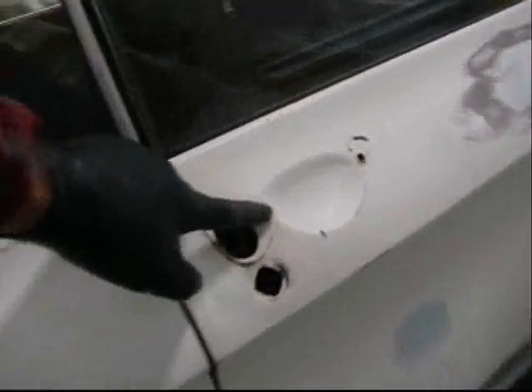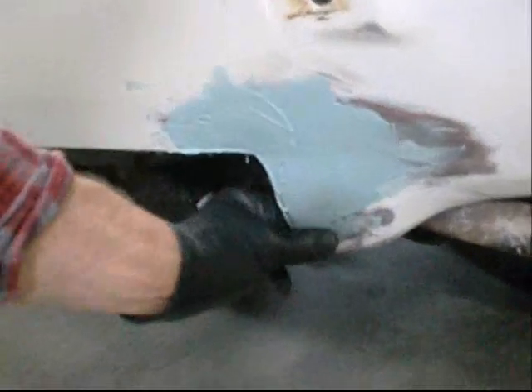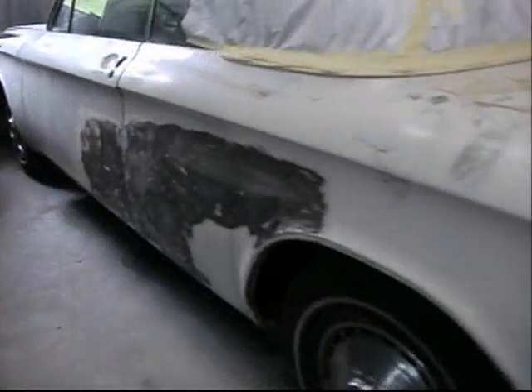Door handles are off — we'll have those all greased up, we'll get a gasket kit. No lead work here, lead's bad for the blood. We'll fix this baby up, get the proper contour back in here. This lip was dragged and the spot weld on the inside was torn. See how loose that is? On this side, stronger. So we've got to re-weld on the inside — there's a second piece of steel. When that lip got torn, it tore the little spot weld inside here, so it'll have to be put back together.